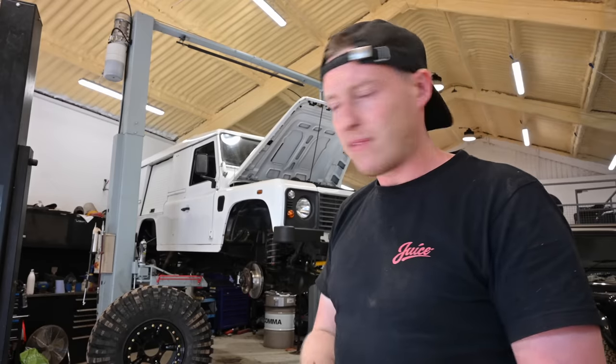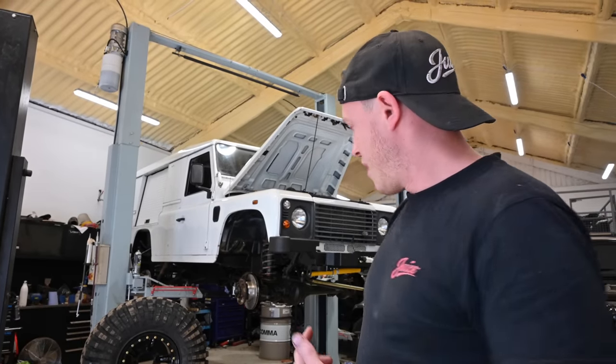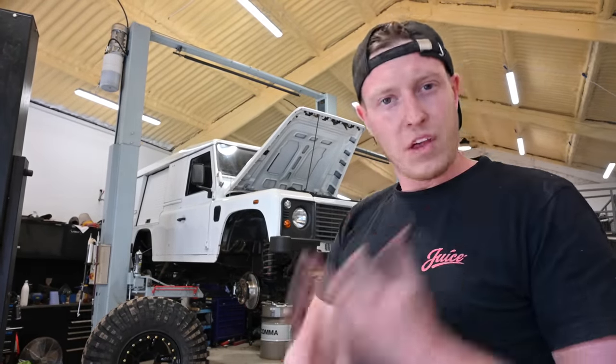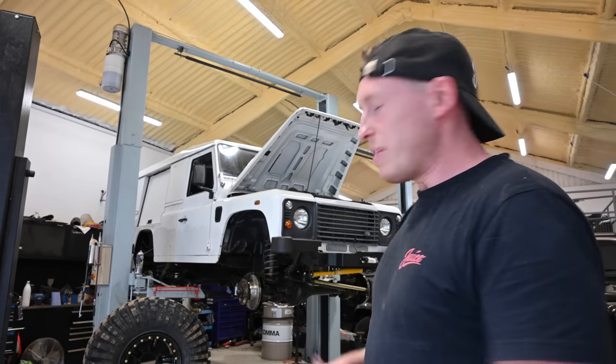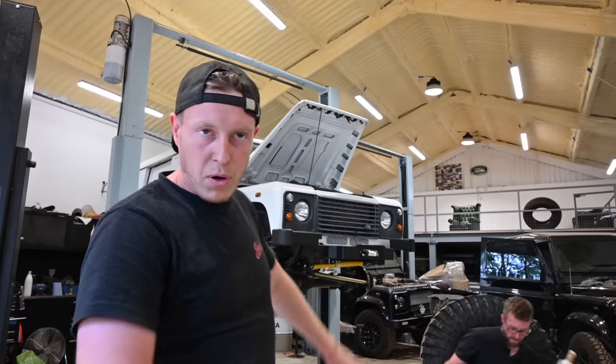It's registered as a Class 7 vehicle. So it's a heavy one, so we've gone for the heavy suspension, strong vehicle bushes, and we've gone for the full kit because we've gone for the 37-inch wheels and tyres. So, pretty interesting one. First thing you're going to see us do is strip down the vehicle, front end axle. We're going to get the front end built up, and then we'll move to the back, all polybushing throughout.